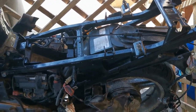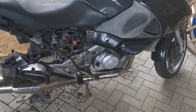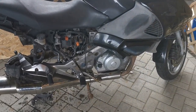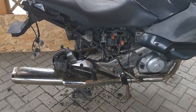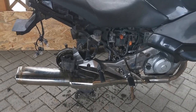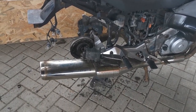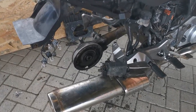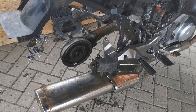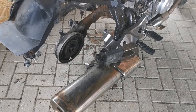At the moment it all seems to be going okay. So this is a week or two later and I got frustrated at certain parts of this — bolts just refusing to come out. I've just had to get the back wheel off which involved using the angle grinder to cut through one of the bolts holding a bracket because it just was not having it. So it's definitely fighting me all the way. The pin in the caliper, I've just chucked a load of WD-40 on to ease it off a little bit because I need to get that out — otherwise there will be no brake pads, and I'm sure you agree that would be quite bad.